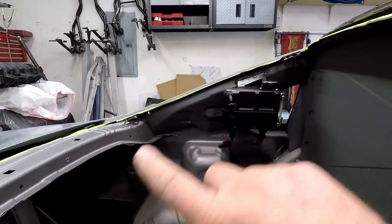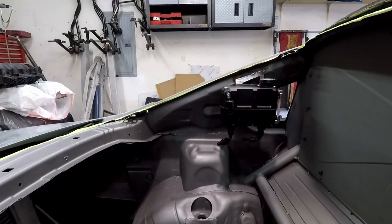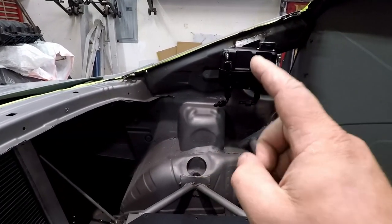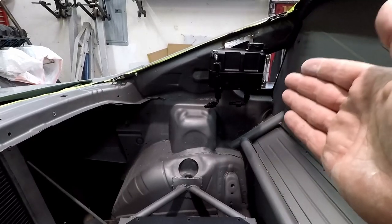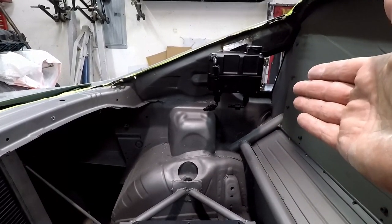So air bubbles come out of the radiator, go into the swirl tank, go into the overflow tank, and not back into the radiator. That means the whole system is constantly bleeding, which means when my engine gets hot, no more cavitation issues, because even if it does cavitate, the air bubbles will go into the overflow and I can drain the overflow when needed.